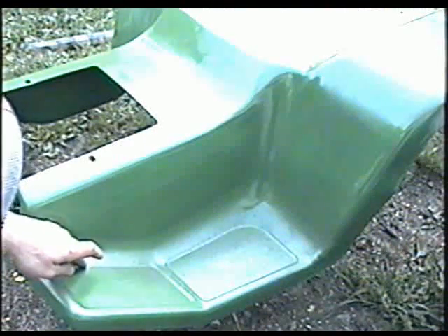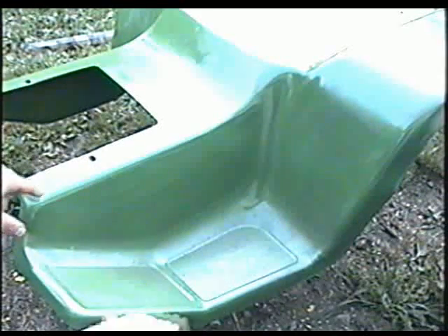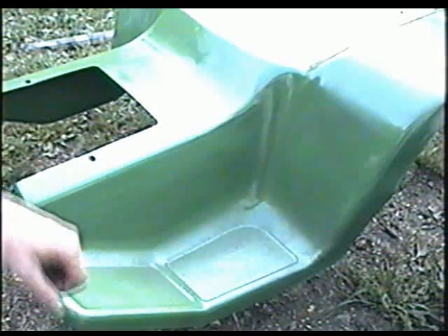Here I'm going to do a quick re-coat. I started painting at this side of the fender, now I'm going to come back here and just give it a light coating. Then that paint is going to dry with the very first layer of paint that I put there. And after that I leave it, then I come back the next day and put a full second coat again.